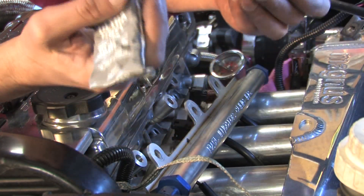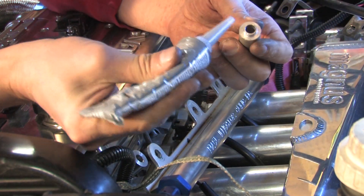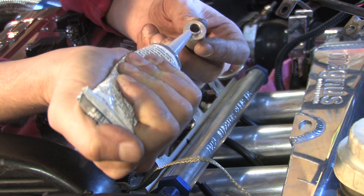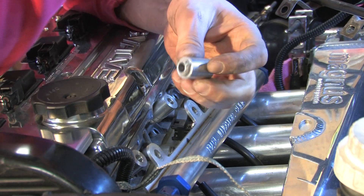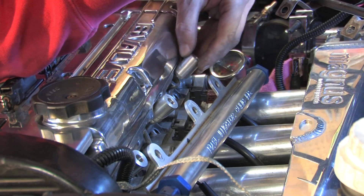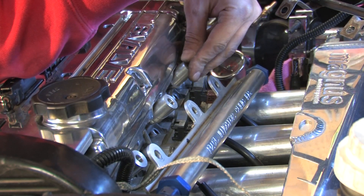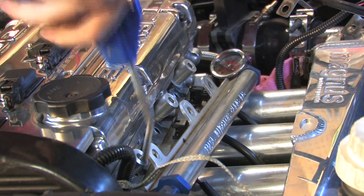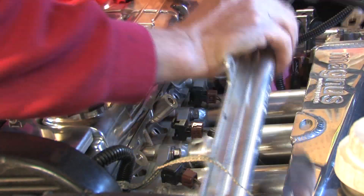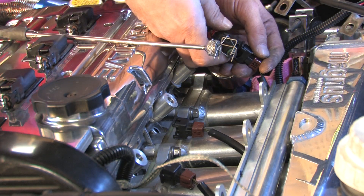This is what I use the RTV for — glue. It just holds this fuel rail spacer in place so that servicing the fuel system is much easier. These are a pain to hold in place while you're installing the rail. Blast the lower injector seal seats clean. I find it easiest to install the injector harness first — that way you don't cramp up trying to put the clips on.